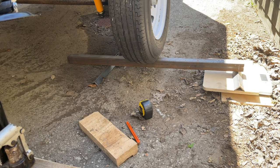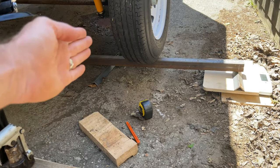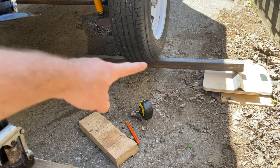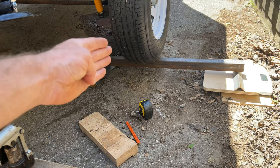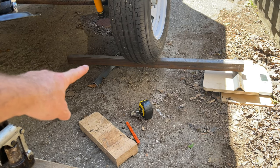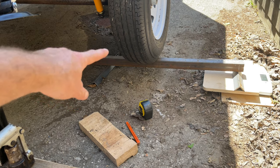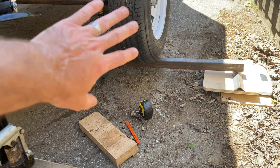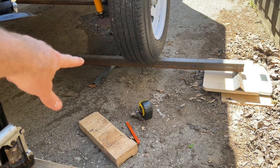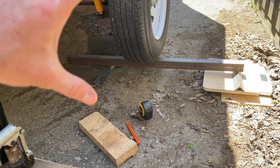So this is the setup for the right hand side. This has got my batteries, a lot of weighted batteries here, and also cabinets. The scale right now can take 350 pounds, so obviously I was over that. That was with the angle iron over here at the far end, an even amount of angle iron over there with the tire resting in the center of the bar. So what I did is I divided the center part where the angle iron was in half, so it was 22 inches before. Now I put it at 11 inches. So that puts more weight onto this angle iron part. Let's get the weight here and I'll show you what that is and then we'll do the calculation to figure out what this whole side weighs.